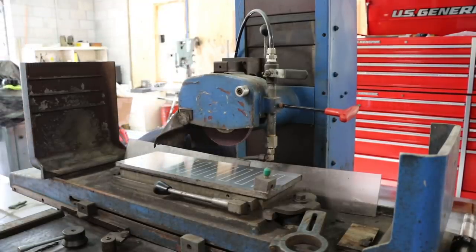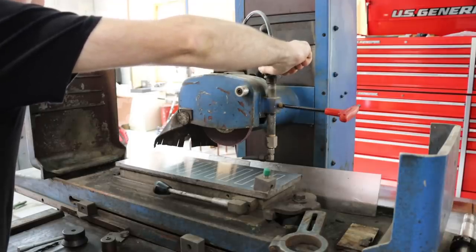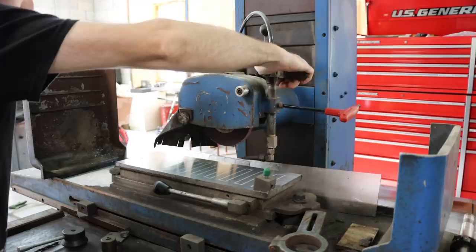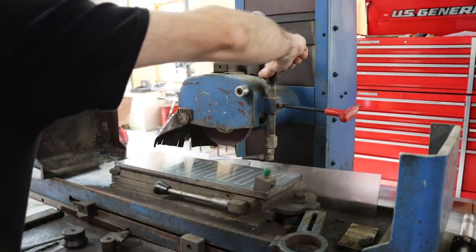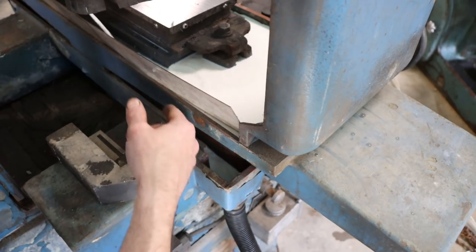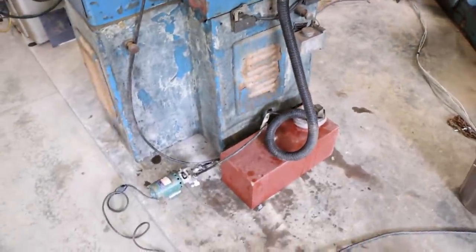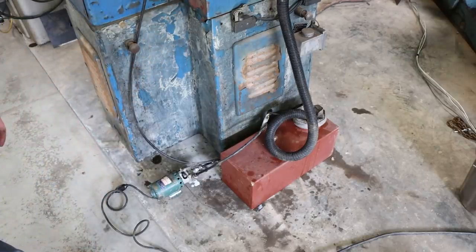Alright, let's turn her on and then we'll turn the valve on. Oh, definitely doing something. Oh yeah — we can make this stop leaking. It's good, it's got plenty of flow. Excellent. So it is a little loud, but the grinder itself is not all that quiet, so it shouldn't make much difference. Having coolant on a grinder is a big deal. So in through here, through the table, out, down into this reservoir, down into the return. Had to fix that leak.